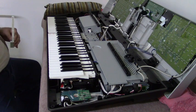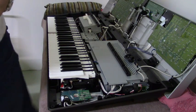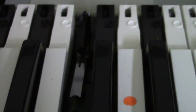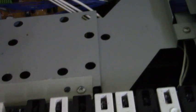You have a key cap that you have to watch for. Okay, you see that grate? They call it a key cap. Be careful when you take your key off. Sometimes that will come off. You don't want to lose it or drop it or step on it. It's just plastic, and it slides down on the base of that key chassis. Okay, and just ahead of it, you can see the rubber from the strip, and there's your spring. When I take these apart, I will lay them all in the order that I take them off. The springs are interchangeable by the numbers, but I just want to put them back in the same place where they were.